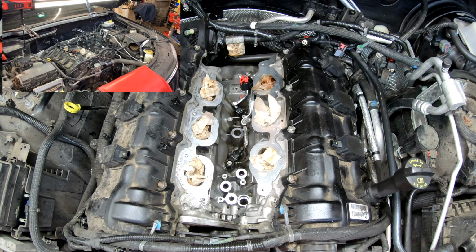All right, so I got the hose for that coolant passage on the back, right from the dealer. I got the gaskets, I got everything except for the knock sensors. So this is the coolant hose. It goes on the back and it has this Christmas tree thing that on this one is so brittle that it broke. So I need to fish it out. The original ones come with clips that you pull out when you install it.